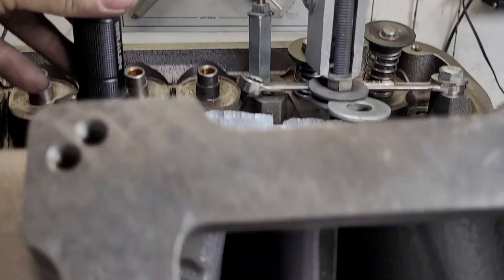And you know what? I have a flow sheet I can show you guys. This is actually what we just flowed. We're set up at 600 lift — notice it's 282 now, 283. It was 285 when it was only 84 degrees; it's 86 now.